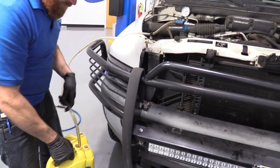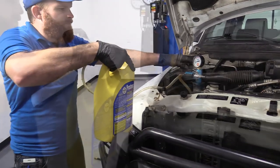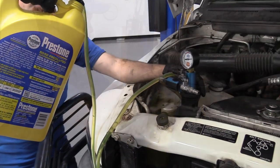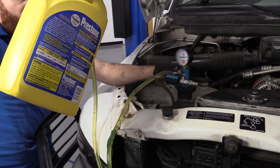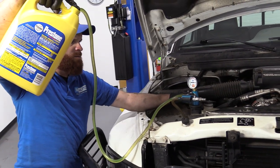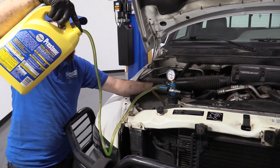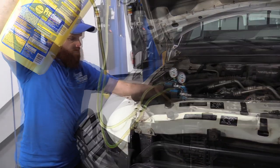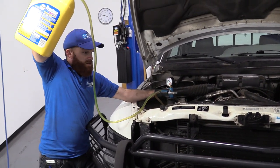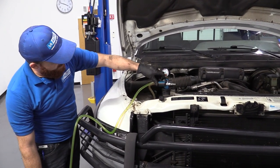It's been holding for a good five to ten minutes, so I'm just going to grab our coolant. We've got our hose down in there and we're going to let the vacuum fill the system. So we're on gallon number three here — I'm just kind of holding it up because the pressure is evening out, we don't have as much negative pressure to create vacuum. I'll just hold it up high and that is it, so we'll let that drain back out of there.